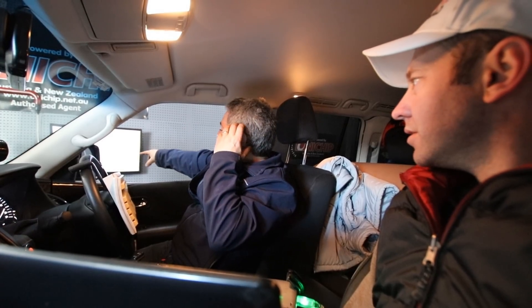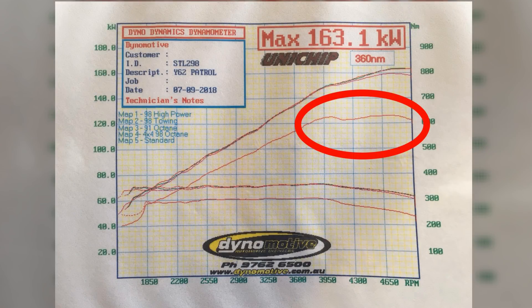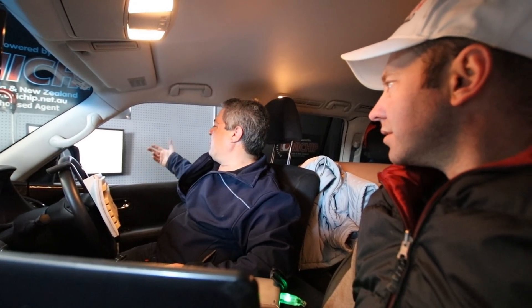That's awesome. You can see where the standard tune goes really rich — the red graph — it's got that dip and it flattens off. You can see where the air-fuel ratio goes that rich, it's drowning the poor thing. It stops making power. Especially with direct-injection engines, they don't need to be run as rich. But obviously the factory does that for the absolute worst-case scenario — things never been serviced, fuel filters never checked, injectors are blocked. They tune for worst-case, probably even for countries like Dubai where they're holding them at 200 kilometres an hour for hours on end.